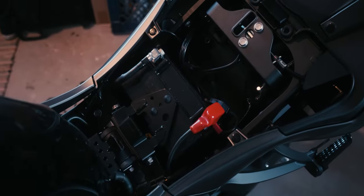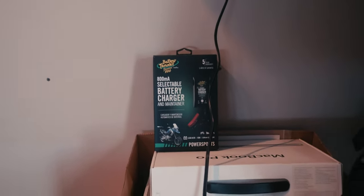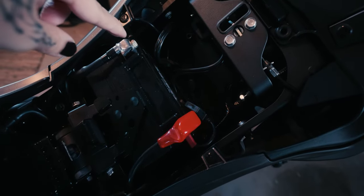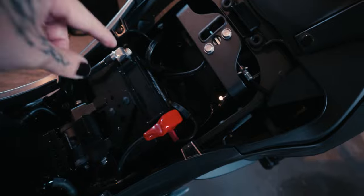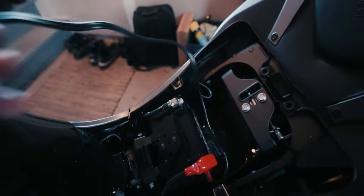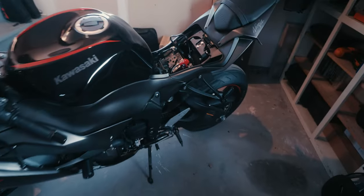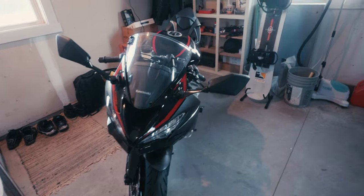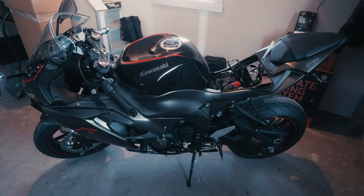I just had to make sure the battery was good for next season. You literally plug the battery tender in and leave it. I'll link the model I have in the description box below — it's like $40, super easy. The install took maybe five minutes. I just unscrewed the negative and positive leads and put the battery tender lead wires on the terminal, stored it, and put the seat on. For other bikes you might have to do a lot more maintenance if your bike is older, but mine is a 2023 so I didn't have to do much.